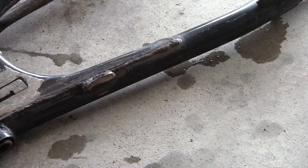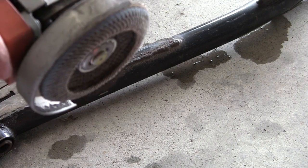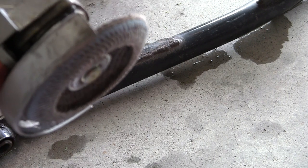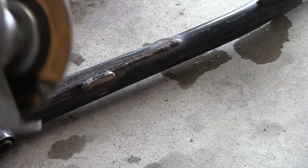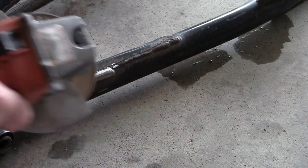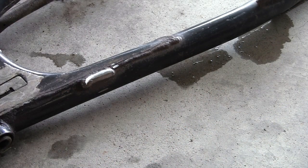We are back and the parts are somewhat dried off, but I don't really care right now because I need to start doing some grinding right here. I'm not going to show you all the grinding but we'll start it. That's where I cut off one of those brackets — I think it was for the rear brake pedal — and I just forgot to grind it off. Regular grinder here, like a Harbor Freight, and I've got one of these real abrasive sanding discs on there, 40 grit. Just keep going back and forth like that. Within a few minutes it'll be done.